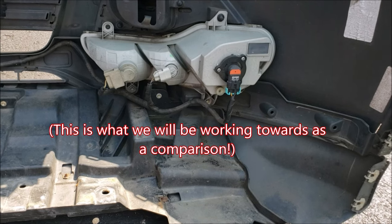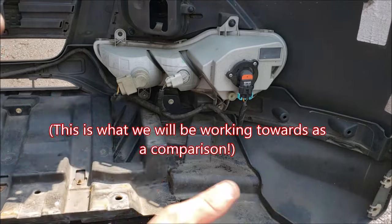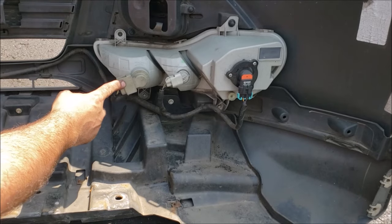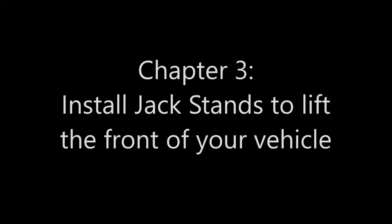If you're going the bumper cover removal route, it's way easier to access these lights. Here is your fog light, here is your parking light, and here is your turn signal. Tools needed include jack stands and associated lifting components, 7, 8, and 10 millimeter sockets or socket wrench with extensions, a plastic pry tool, optional socket U-joint, Phillips and small flathead driver, a T30 Torx driver, and an optional power drill.